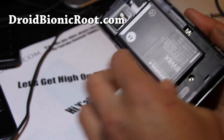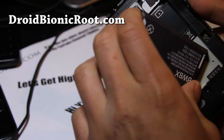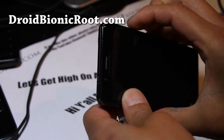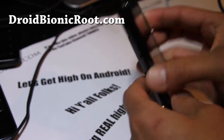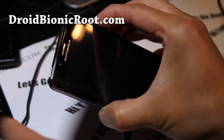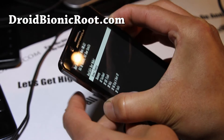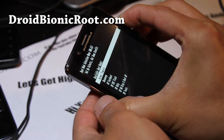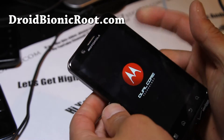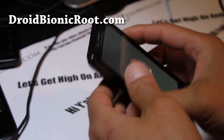Now here's how you do it — I finally figured it out, it took me like a whole day. What you do is if you run out of battery, hold it in and pull the battery out, hold down volume up and volume down, and then plug in the USB cable from your AC charger — not your computer — and then you'll get the normal power-up screen, hit power, and now it will power up.